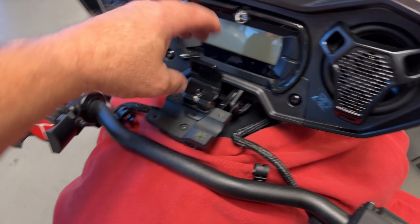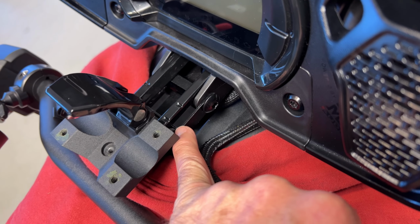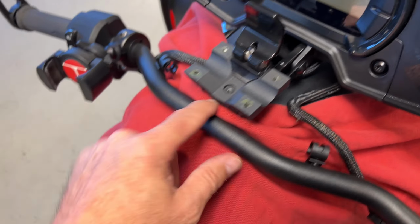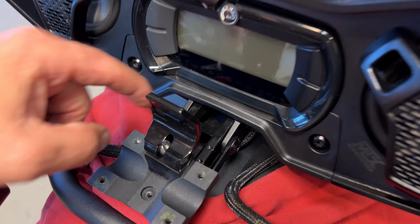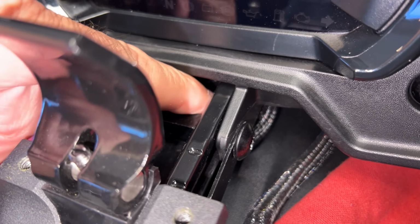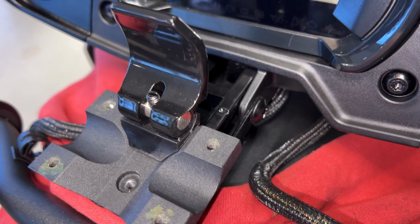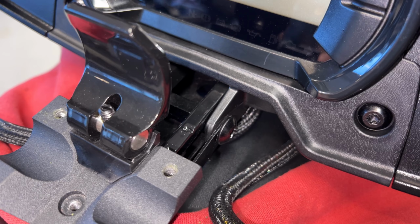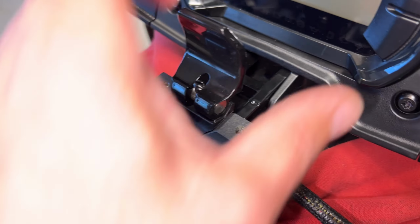The pinch plate that's underneath there so that you lock the handlebar down wherever you want it, that's that bracket I was telling you about that keeps it from going forward. It's just a U-shaped thing. So that plate hits the back here and stops it as well. That bolt is just a safety thing. So if you can make it out, there's a hole up there where you have the steering stem off, which I got to get off first, and I'm stuck. This bolt has to go all the way through that hole up there. And so what I'm hoping is I can loosen this, take this limiting plate, slide it forward enough.